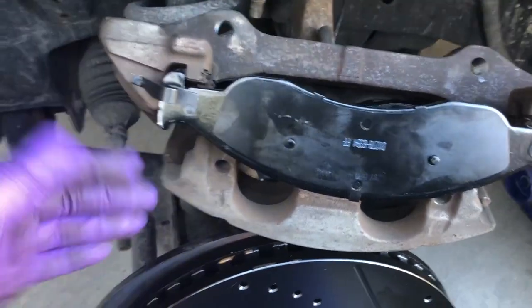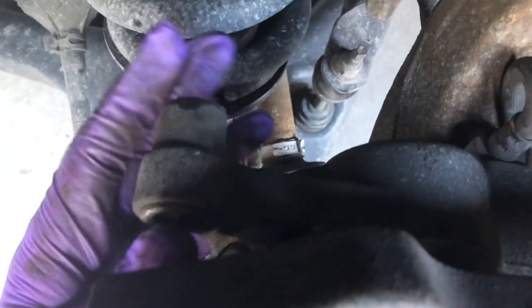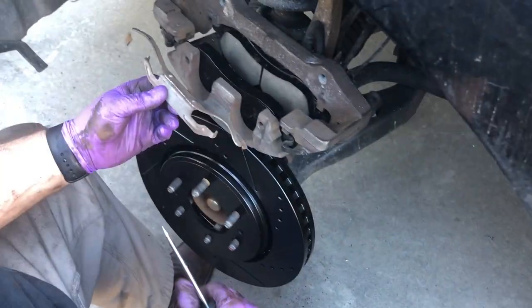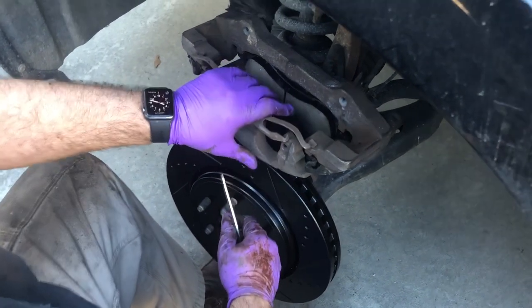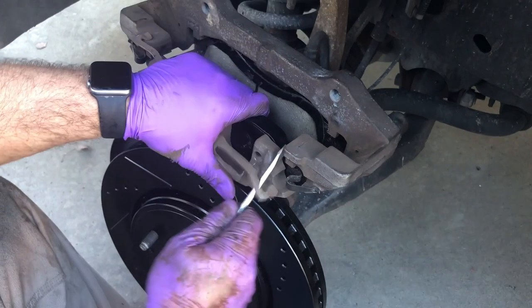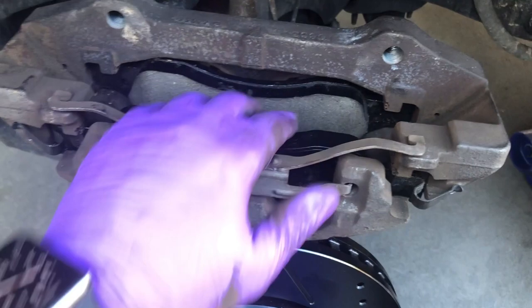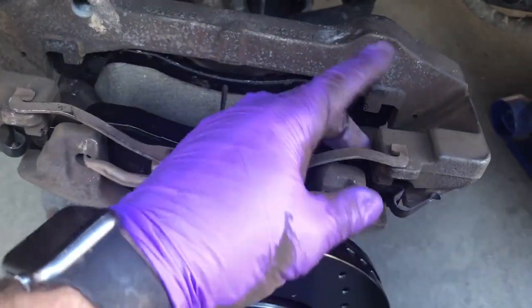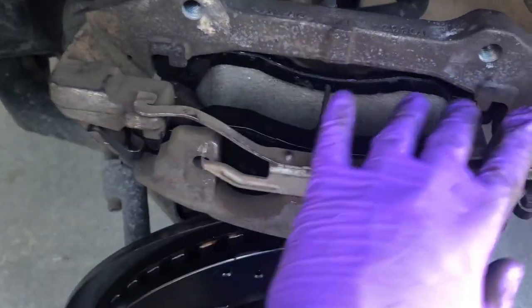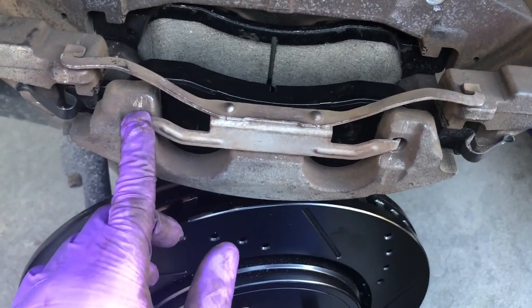You kind of have to sweep it in and line up the caliper hole on both of these, this part here, and then this part right here on this casting. Okay, this fits on here like this, and basically what I'm going to have to do is mash it down, and then I'm going to use a screwdriver too to help get this little twanger. Okay, so this is what it looks like installed. Basically, I set this portion here and this portion on these two, and then I just pushed down on this and got this in alignment with those two holes.